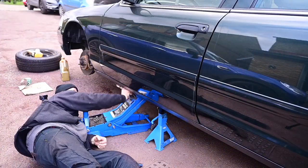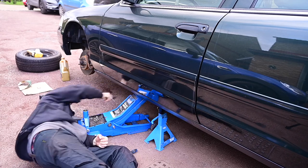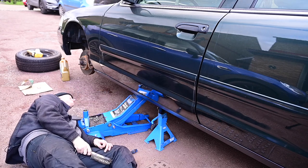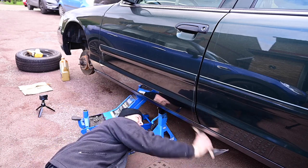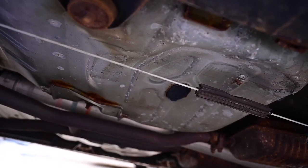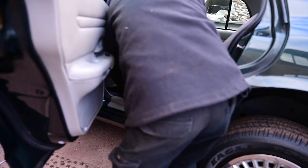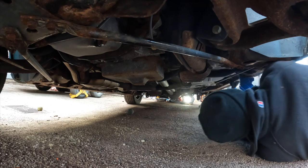The floor pans are absolutely amazing, but the heavy duty chassis rails have got some surface rust on them. So I'm going to give them a quick wire brush on the worst parts, then hit them with some underbody sealer rust-proofing material in a can. I was going to use the compressor for all of this, but because they didn't have any in Halfords I'm just going to use aerosols. Oh — there's a massive dent here in the boot where this has been parked on something heavy quite hard. I think I'm going to whack this with a mallet on the inside first. A big block of wood to spread the load.